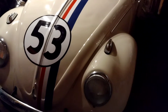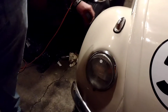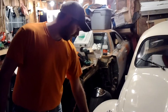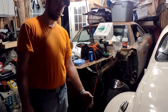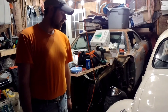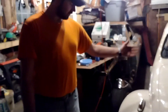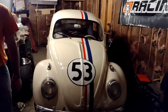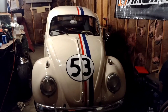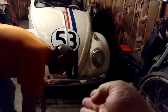There's some runs on it, there's some imperfections. But you can fix it - a little sand, a little buff, it comes right back around. I had a lot of buddies in the car paint world along with YouTube. Take your razor blade, scrape that high side off after it's packed and hardened up, then you wet sand it - with finer and finer - and then you buff it. Now I don't see the run. When we painted it, we put hardener in it - we thinned it and we hardened the paint. Shot it through a Harbor Freight gun.